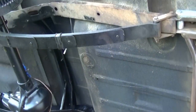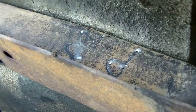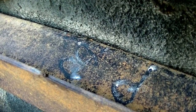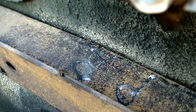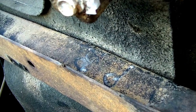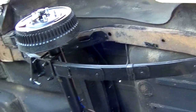Back working on the 62 GT frame. I wanted to show you something I found that I thought was pretty cool. Right here on the frame — hopefully you could see that in the camera — it was 'PB' written upside down, because the frames started on the line upside down. I believe that's 'power brake,' telling the workers on the line that this car would get the power brakes, so it required a different brake pedal pivot to be installed. A little bit of South Bend 1962 left.